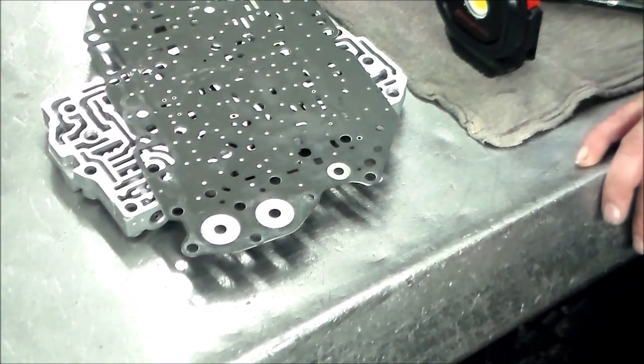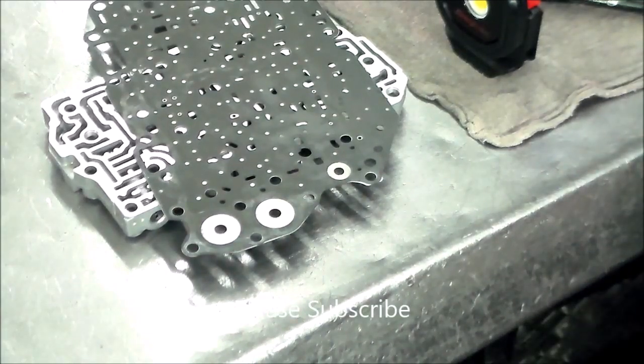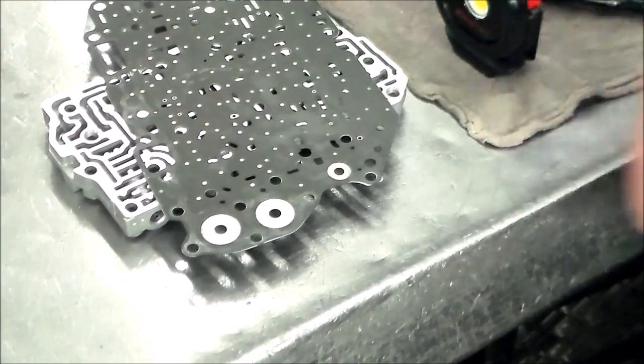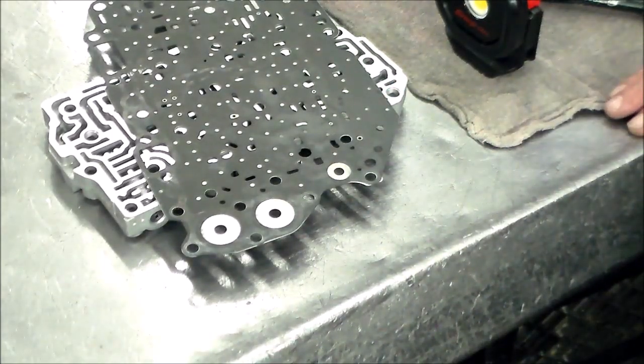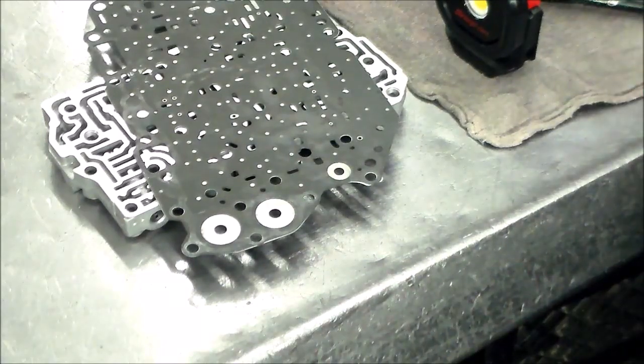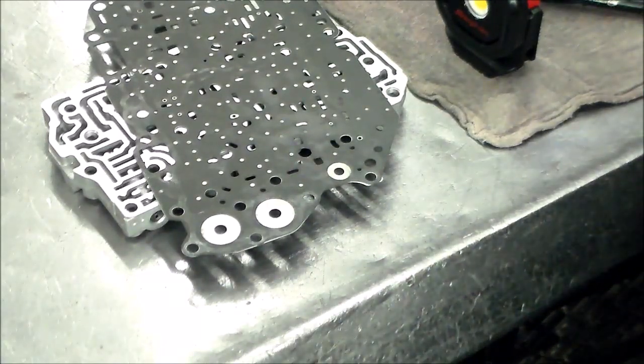That is about it on this 2010 Mazda CX-7. Overhauled it about a month ago, she came back yesterday claiming it wasn't shifting right, gave me a P0734 gear ratio error in fourth, and we found a piece of silicone stuck in the feed hole. It's very busy here — I've got a 4T40E, a 545RFE, another FNR5, a 510, and a Nissan unit to do. I'm going to get this back together and back to the customer. Thanks for watching, have a great day, and we'll see you on the next one.